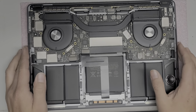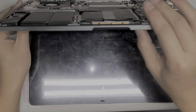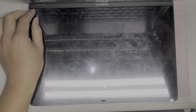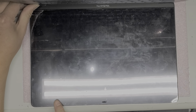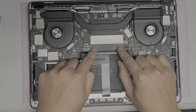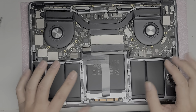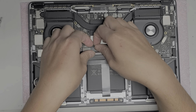Once you remove the cover, the first thing you want to do — if you didn't already — is make sure the Mac is off. It's probably going to turn itself back on, but you want to make sure it's off. Their screen is completely blacked out — there's a crack here. Anyways, make sure to turn off the Mac. I can't see the screen, so I'm just going to press and hold the power button until it turns off. Then make sure you've grounded yourself — touch the floor or something metal — and make sure that you don't have any static electricity on you.